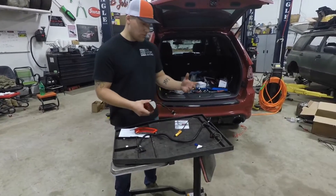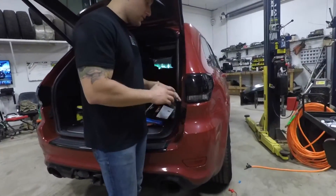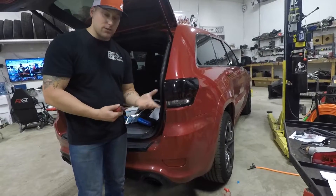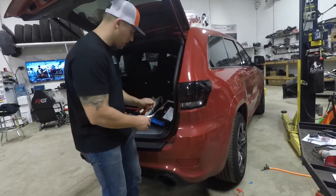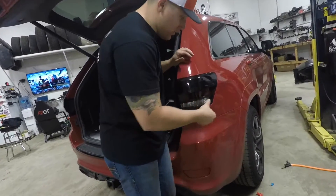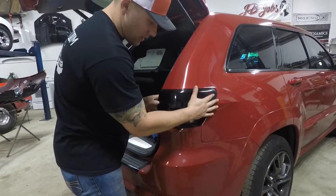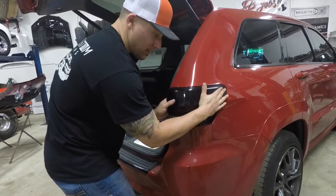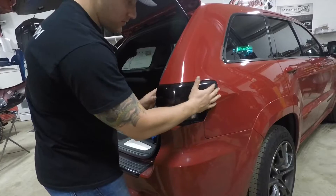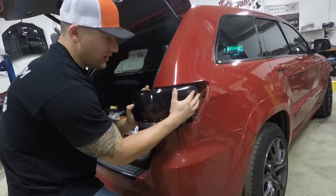I'm going to show you how to plug everything in and run the wires. Here we have the tail light — it's pretty basic to take off. There are two pop clips; use a tool like this or a flat head screwdriver, just make sure you don't break them. We already have those removed, so just pop them out. There are going to be two knuckle-and-socket type connections on the side, so put one hand here and one hand there, and press while pulling this way — don't pull straight out or you'll snap them right off.